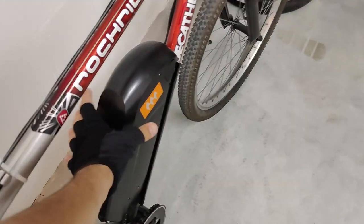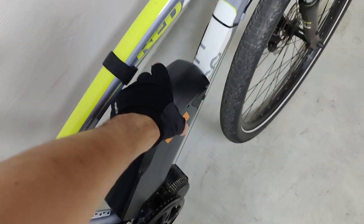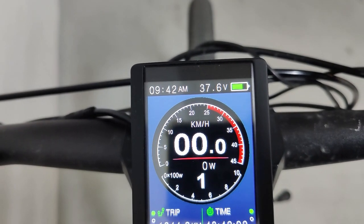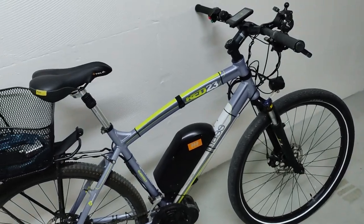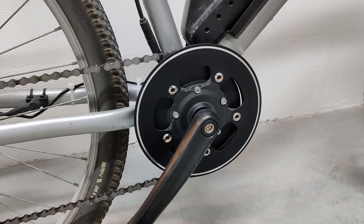Back to the test — I had my round trip, this time without any fatigue. I connected the used battery to the Bafang bike and I had this: 37.6V. It might be just a random number to you, but I couldn't believe it. Let's put it back on our old chart. Do you see it too? After those custom modifications on the TSDZ2 firmware, not only is the behavior closest to the Bafang one, but I consumed exactly the same amount of current.